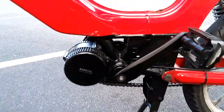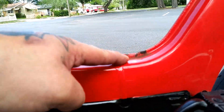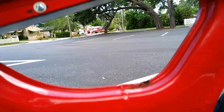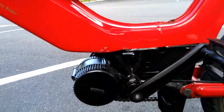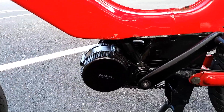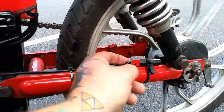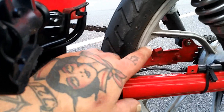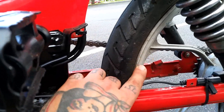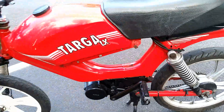I'm going to be adding a bolt that goes through the bottom here, where the old kickstand was on the bike, up through the frame, just for extra support for the motor in case it was ever impacted in any way — so it won't have any way to fall off. I also need to hook up the speed sensor still. I'm going to use JB Weld and just put the magnet on the wheel at some point and get that sensor lined up.